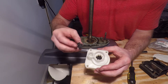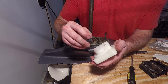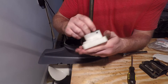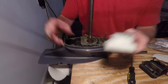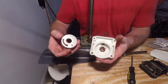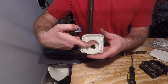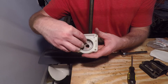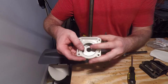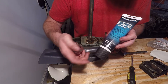The first thing you're going to want to do is put the grommet into the water pump base. There's a hole on one side of the base and it corresponds with the tab on the water pump grommet — feed it through and get that tab lined up through that hole. Next, put your new water pump cup inside the impeller housing. You can see there's a tab here that helps you orient it properly. The slot here lines up with the slot there — that's where the water is going to come in. Put it down in there and twist it around so it sits in nicely. Before putting it in the housing, add just a touch of grease on the outside so next time it'll be easier to take apart.